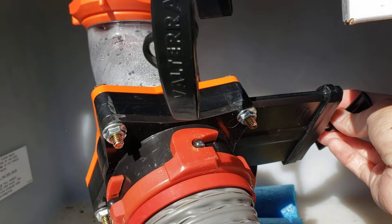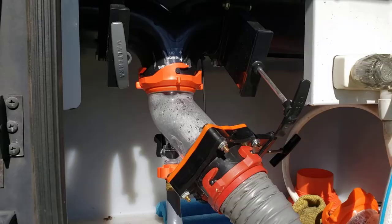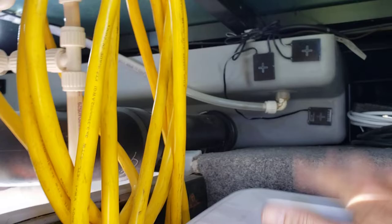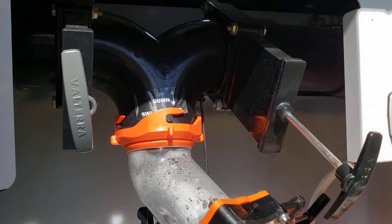You've got this valve here that you can shut on and off. Of course you've got your gray valve, you've got your black valve. Our goal is to do a back flush — clear the clog. With mine, let me show you how it's set up. You can see this pipe for the black tank comes around the corner right into the black tank. I'm assuming I had a clog right there — maybe driving around shifted all the toilet paper and created a clog, maybe in the elbow. Either way, when I did this trick it unclogged it and worked just fine.